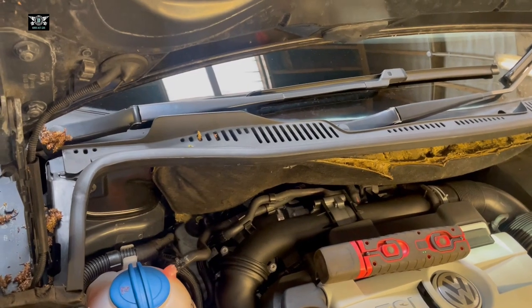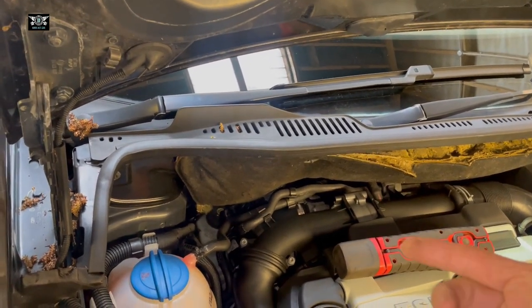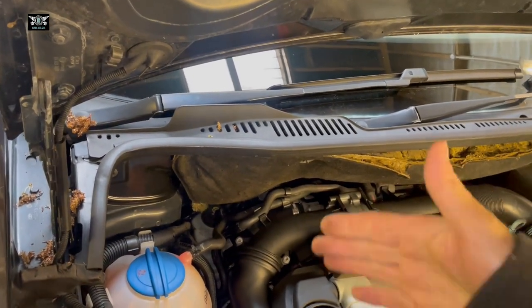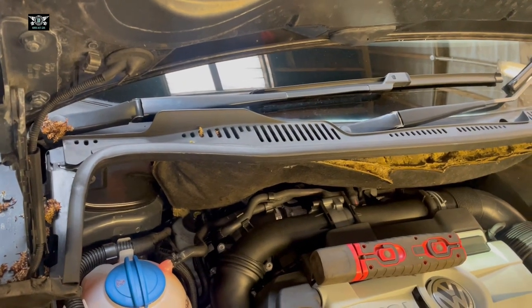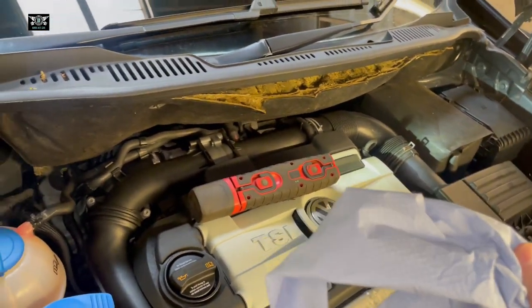However, it looks like if I push the front and rear pads, the fluid may flow out. So just in case, it's a good idea to put some paper around there to absorb any fluid coming out, because you just don't want it to go all over the chassis and the bodywork — it can be a little bit corrosive.